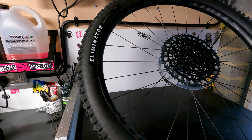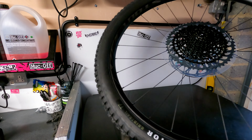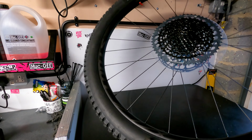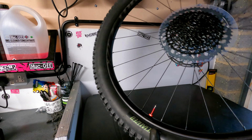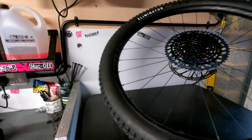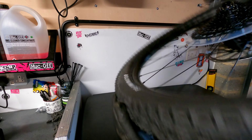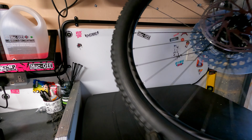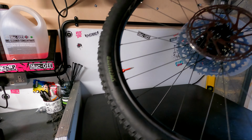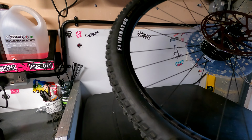Once inflated, have the wheel at a slight angle and slowly turn it so the fluid runs over where the bead seats onto the wheel. Go all the way around on one side, then flip it over and do the same again. So that's how you make a wheel tubeless. You just need to do exactly the same with the other wheel.